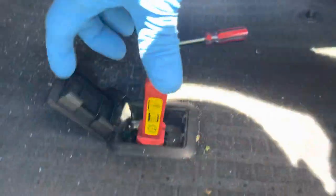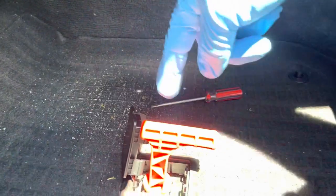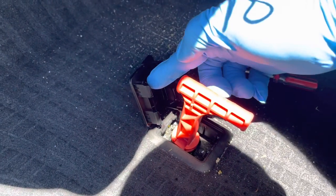Take the tool, insert it into the square hole — it's going to sit just like this. Then take the tool, turn it to the right hard and push it down. That's going to put the vehicle into neutral. Sorry for the video, it's super sunny — so that now is in neutral.